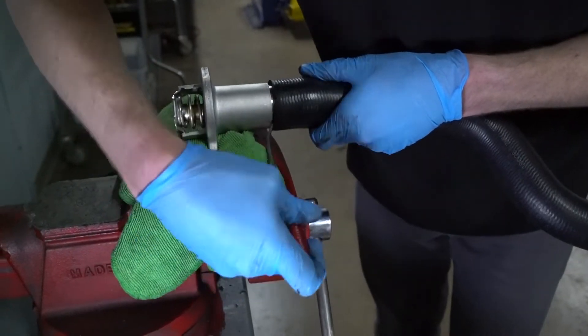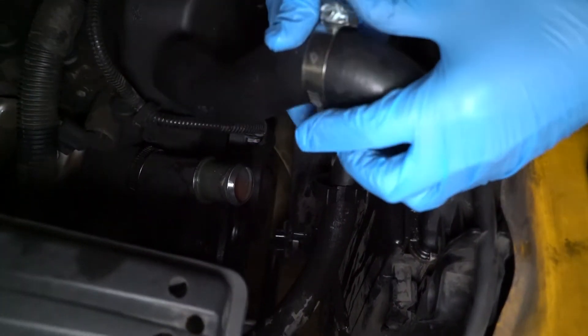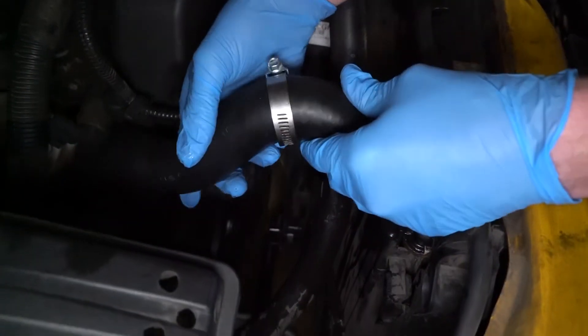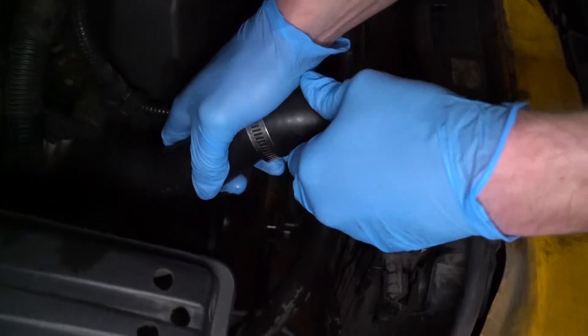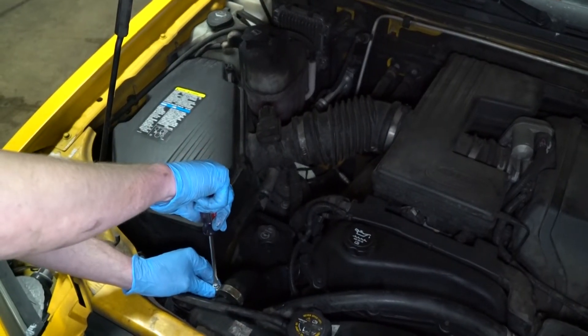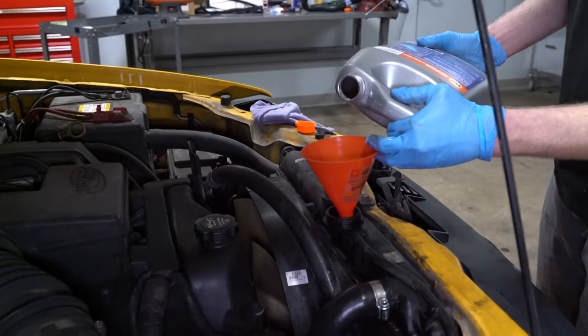Be extra careful with plastic radiator fittings. When installing the new hose, it's a good idea to replace the spring clamp with new screw-type clamps, since the spring clamps can get weak and frequently break after one or two uses. Check with your Haynes manual to find which type or color of antifreeze your vehicle needs, as some of them are incompatible.